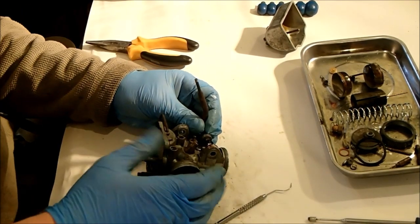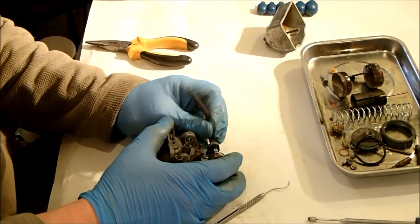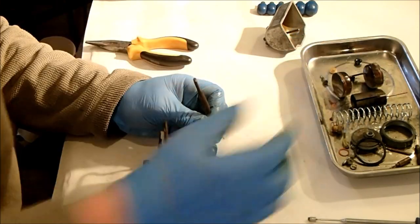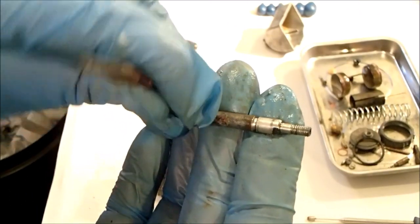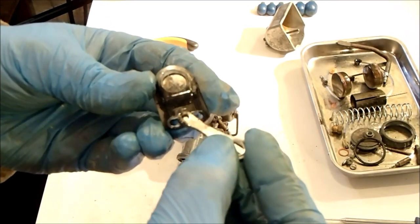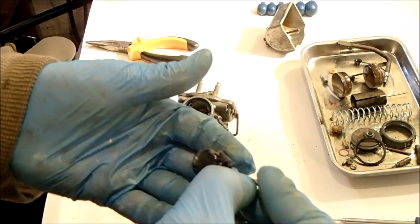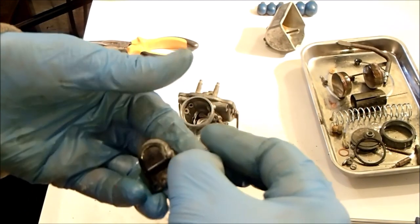Is this spring-loaded? So as you retract the lever, there is this rubber dust cap that goes in the gap between the two, and then the lever comes out, and the lever has a small key on it, so I'm assuming that engages with the lever mechanism. This lever sits on top of the slider, and as it's ratcheted up and down, it's allowed to slide in this area here. To get it out, it took me a while to work out, you have to drop this right to the bottom, so effectively the choke is closed, and that allows you to disengage the lever and pull it off. You can't do it while it's in the up position.